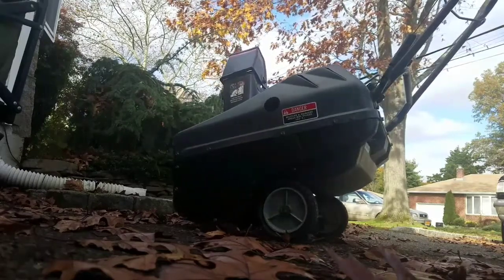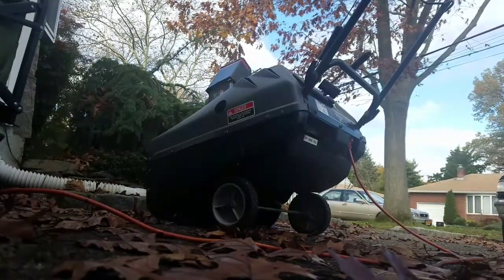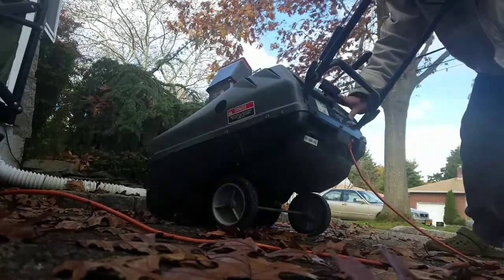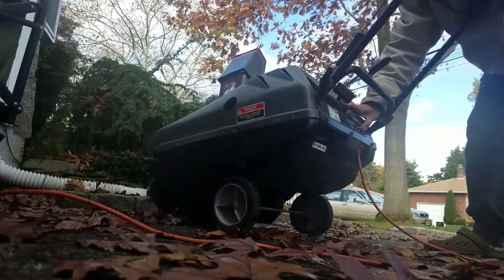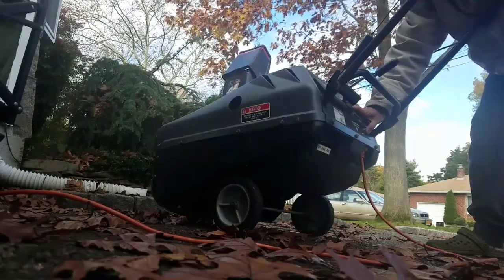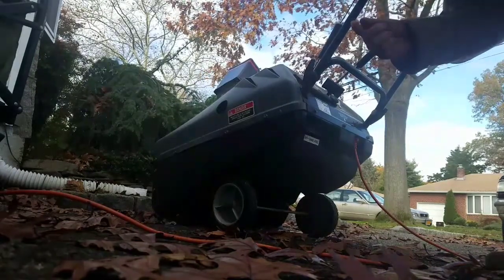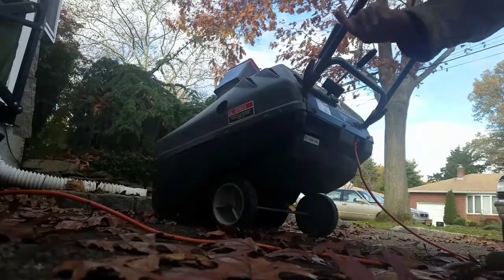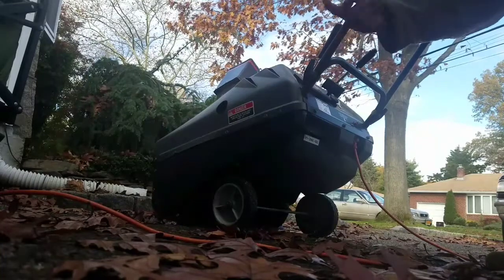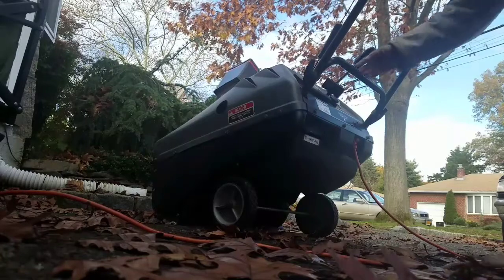I'm going to try electric start. So you just hook up your electric cord there. It's not going to work because the starter is just spinning. It's not moving up with the spin to grab onto the gears of the flywheel. So that needs to be greased, which is probably the reason why it hasn't been used that way. So that's not going to work.